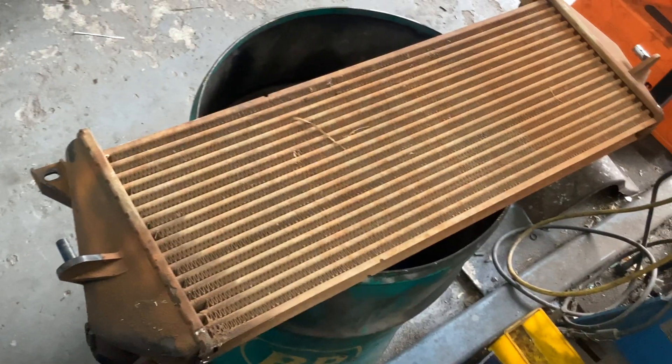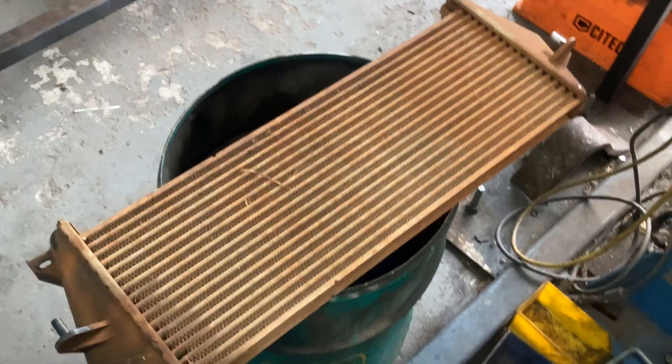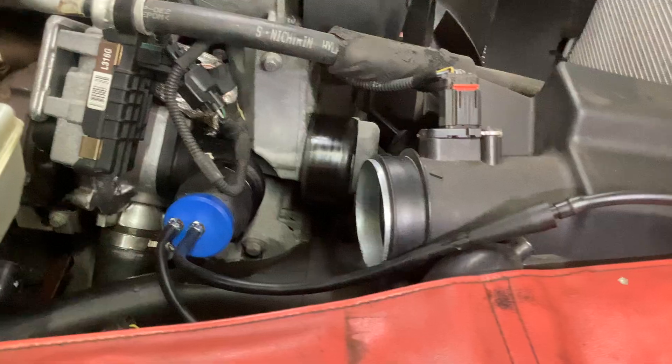Here's one I prepared earlier — that's the fold I was talking about, this is what blows out. This is the driver's side one. This is the same part number as the previous model Defender, the TD5. I replace them with all-aluminium ones that are all TIG welded, really nicely made. On this particular vehicle, the intercooler's good and the two hoses are good.